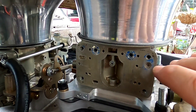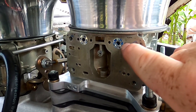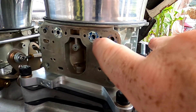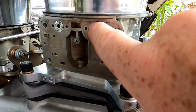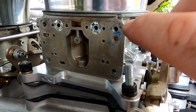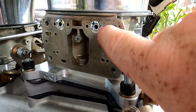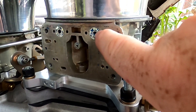One of the cool things exclusive to Allstate Carburetor is the way they install boosters. Jim and the guys at Allstate have developed a way to actually thread the booster and install a flange nut on it. They drill and countersink the main body, then screw the booster in place. That is added protection ensuring the booster is not going to come loose or fall out into your engine.